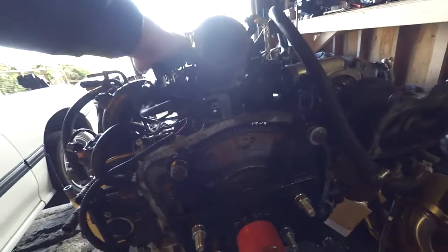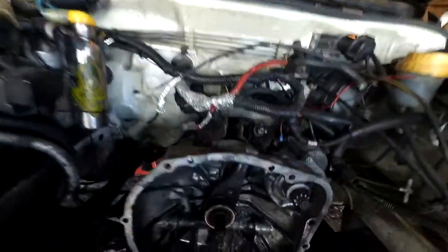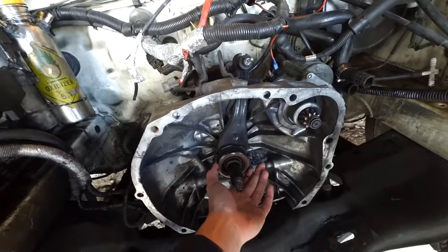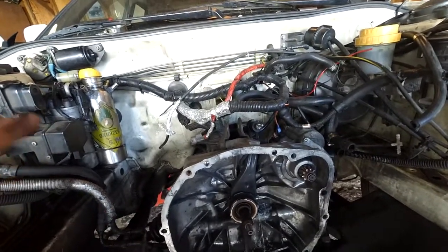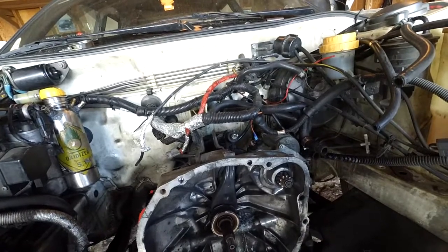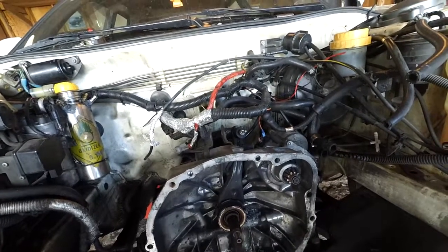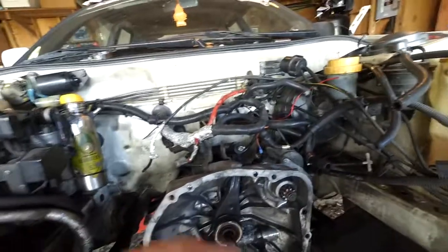It'll be a little nicer but rated to just over 300 horsepower. The only question is whether that will work with my cable clutch old transmission with the older style throwout bearing — because they updated the throwout bearing style for those newer WRXs. I believe the diameter is the same if not bigger, so I think it'll work. But I can't find anyone who's actually put power through this non-turbo transmission using a newer push-style clutch setup with the cable still running it, so I hope it works — I guess I'll find out.